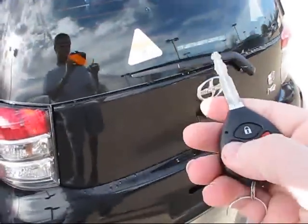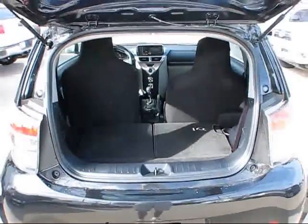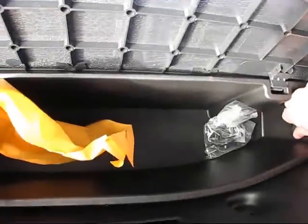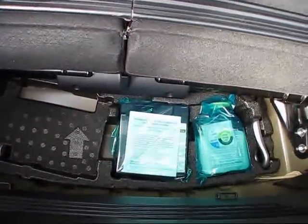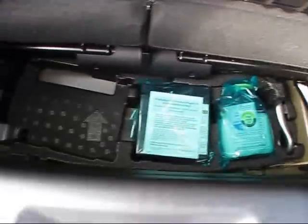The trunk is not releasable by the key. Instead, there's a small push button located on the small round handle — just press it and that opens the trunk. With the rear seats folded down, you are allotted 3.5 cubic feet of cargo space. But there's something interesting: if you lift up the small pad and this area, there are two clips at the bottom of the storage tray that simply twist out, revealing a tire repair kit underneath. It fills your tires with a special liquid to prevent complete deflation — just enough to get you to the nearest tire station. Thus, this vehicle saves weight by not including a spare tire at all. You can fit the clips back into place and turn them to lock.